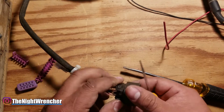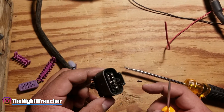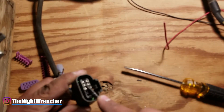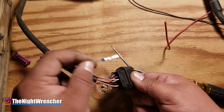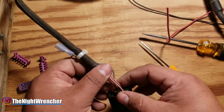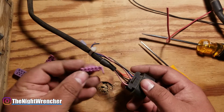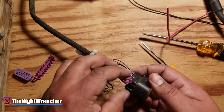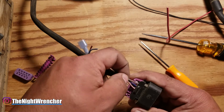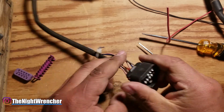On the second connector, there's a gray wire — the tach wire — that we're going to want to pull out. Hold the connector, pull on the wire, lift on this lock, and the wire comes right out. To put the wire separators back on, open up the middle of the wires, grab the wire separator, stick it in between the wires, and guide them to the appropriate channels on both sides. After the wires are guided in correctly, just push and it's all good to go.